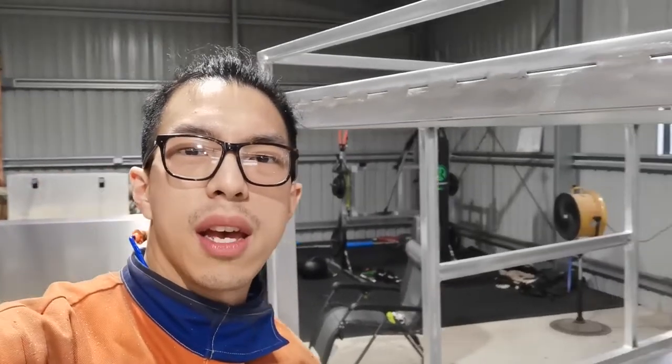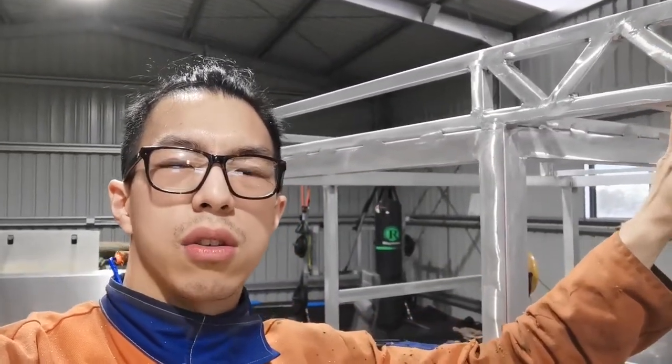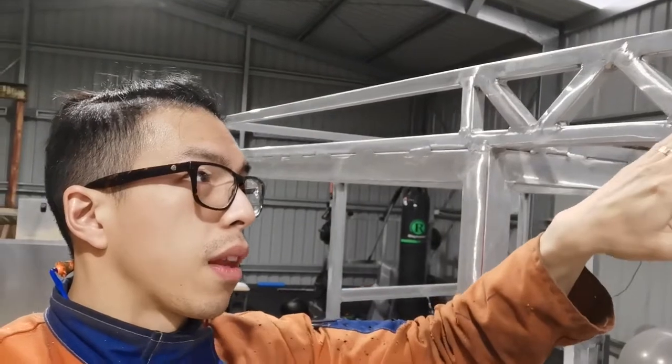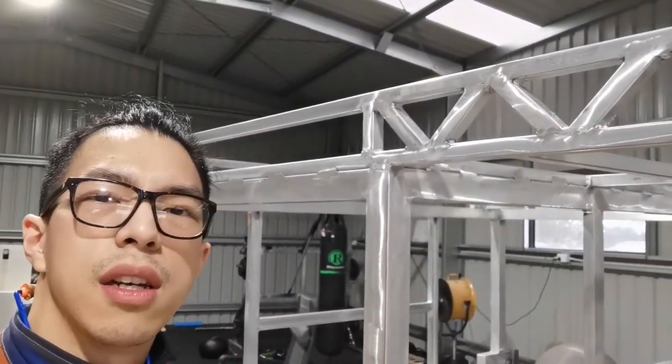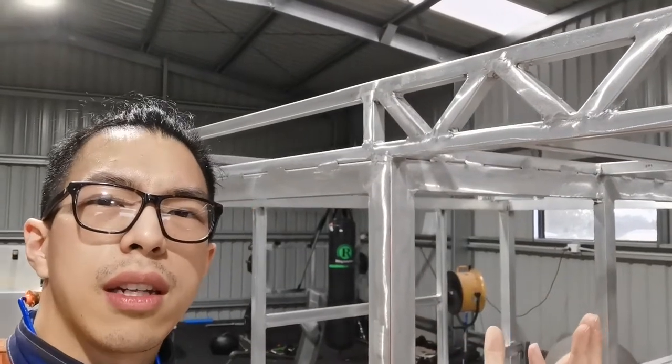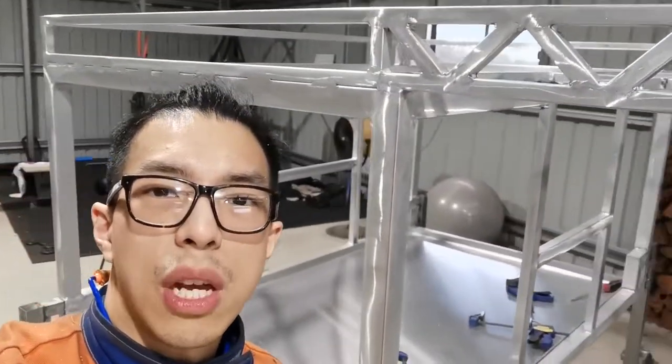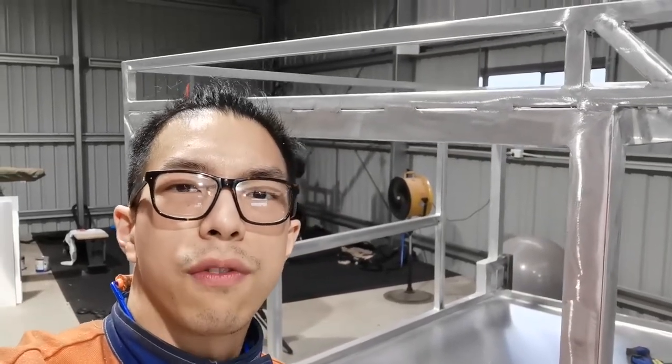Alright, I just want to share a good tip about gluing aluminium sheet to aluminium frame. So aluminium to aluminium, if you like. Or I think that probably applies to all, metal to metal, metal to plastic, or metal to wood. Before you actually apply the glue, you have to scratch the surface of both sides. Obviously that's because of the surface area, and then the glue grips a little bit better, so it's unlikely to come apart. I haven't tried this before, but I think if I follow this direction, it should work very well.